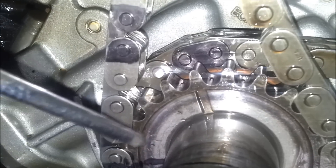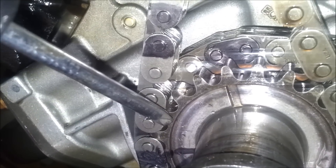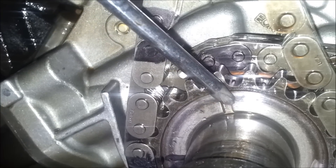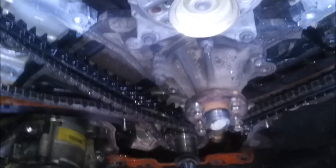So if I was to turn the engine counter-clockwise, as the engine is turning, this bottom mark is going to line up with that too. These two are going to line up, these two are going to line up, these two are going to line up, and then my mark and my link are going to line up. Don't be afraid to think outside the box — it works.